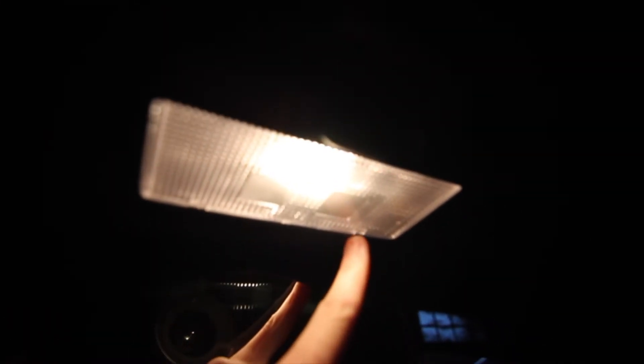The two things you're going to have to use to remove it are these two little indentations — one right here and one right here. You're simply going to go in there with a flathead screwdriver and pop them out. Before you do that, you're going to want to move your mirror so that you get enough leverage and you don't end up scratching it.